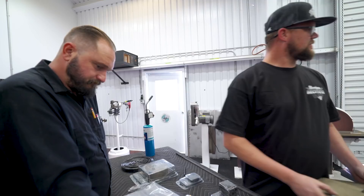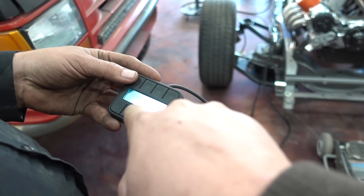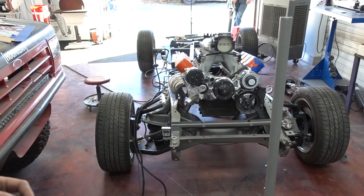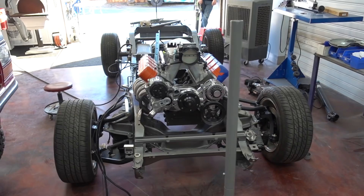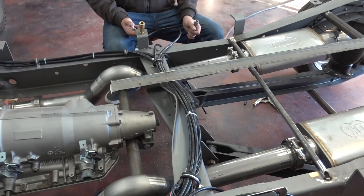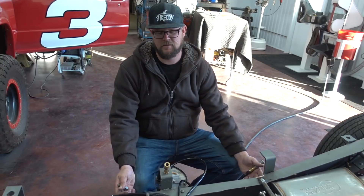Check it out — left front, right front, left rear. Mike's been working on the fuel pressure regulator. Usually I put them on the firewall, but I didn't want to because we want everything to stay attached to the chassis as much as possible. So all the fuel system stays on the chassis. We have no exhaust hangers on the body, no air lines on the body. Hopefully we can fit the tank and compressors both on the frame. The whole air ride system doesn't attach to the body — I'm trying to make the chassis as complete as possible.